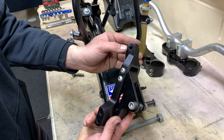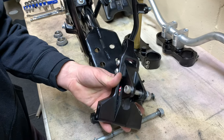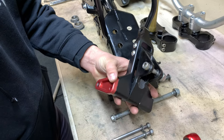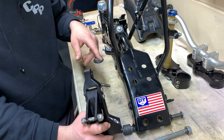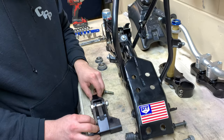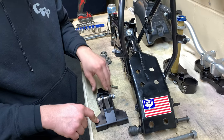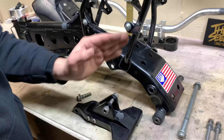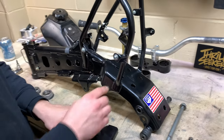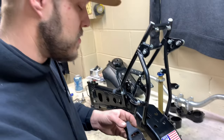This is actually Rig's KLX 110 shock bracket. It's a three-piece bracket — you've got a bolt hole at the top, and these side pieces mount on either side. Something to note about building a full mod with a shock relocation bracket is that a lot of the old-school brackets do not fit a 2010-plus frame, because the subframe was built to hold a battery and comes up at a different angle than pre-2010, which can cause clearance issues.